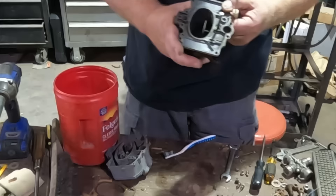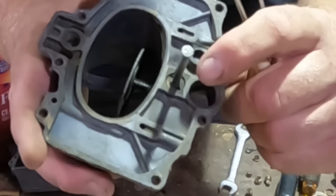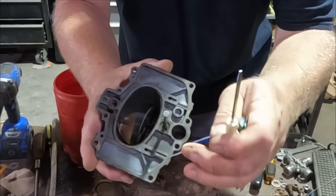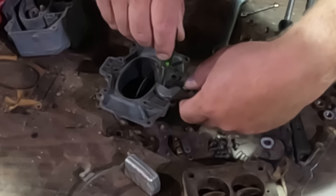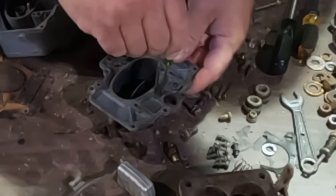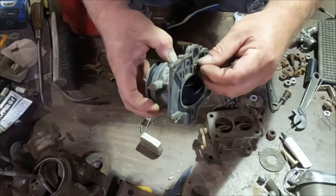There's something that looks like it unscrews — there's a flat blade slot across it, but something's in the way. They probably make a special wrench with a tang on either side, but I don't have one. So I'm going to use two tiny flat blade screwdrivers, one on each side, and use a small adjustable to twist them. Then you just unscrew it without any damage or having to get the special tool.